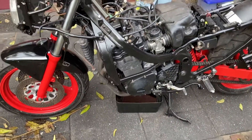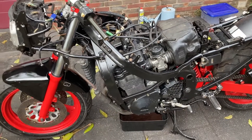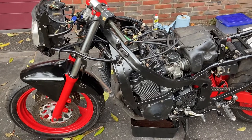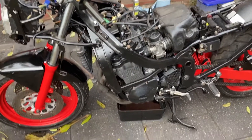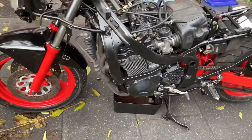She spits some fire, so probably the carburetor is going to need an adjustment. But first I'm just going to run her to free up the rings and things like that, and then I'll adjust the carburetor. As you can see, the oil is running out now, so I'm going to wait a few minutes before taking off the front.